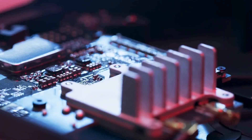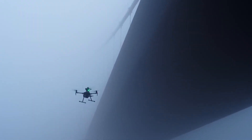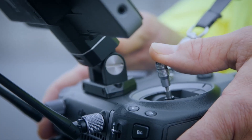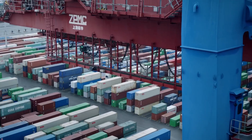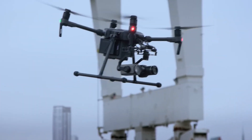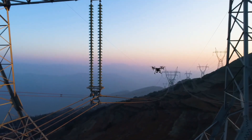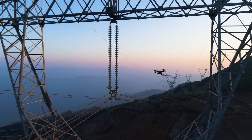After use, make sure you store your M200 correctly following the guidance in the instruction manuals linked below. As part of your post-flight checklist, always check the connectors between the intelligent flight batteries and make sure the surface is dry, drying up with a towel before storing away. The aircraft arms and locks should be dry before unlocking and folding the arms. Also make sure that the upward and downward gimbal connectors are fully dry before storing your drone.